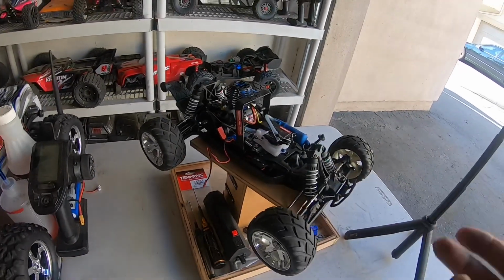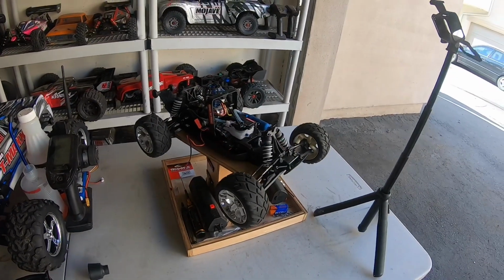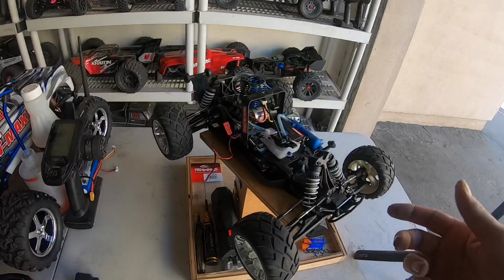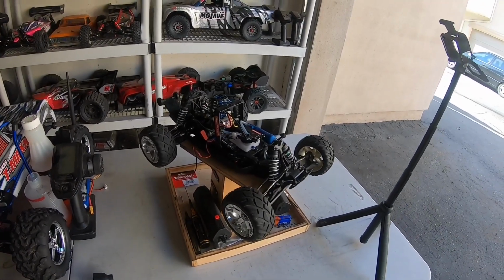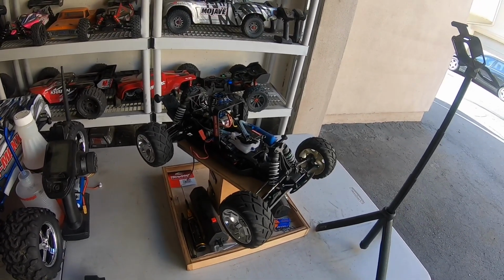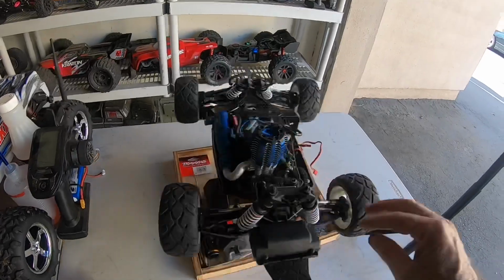So can you run it with the double idle? Yes. Is it gonna hurt anything? No. But just getting it tuned perfectly is just a better way of doing it. Just so when you let off, it drops right to an idle, so that when your fail safe kicks in in case the voltage drops down, you don't end up with a high idle and it trying to push the brakes when the brakes are applied. Especially on a Jato that doesn't have the best brakes in the world.